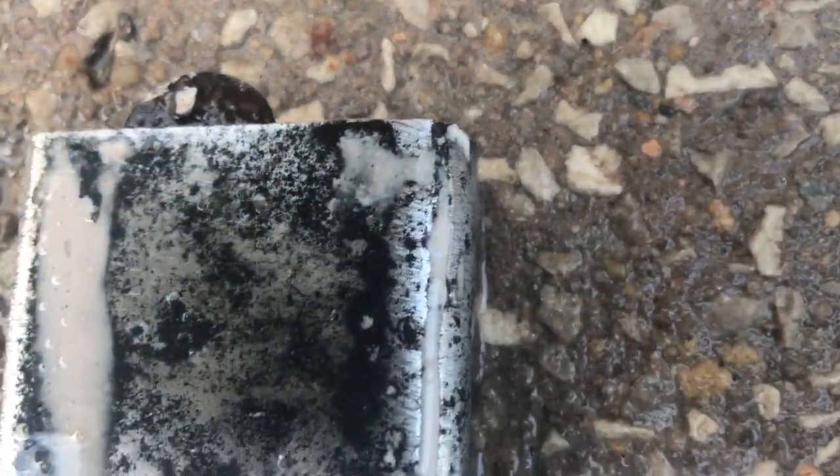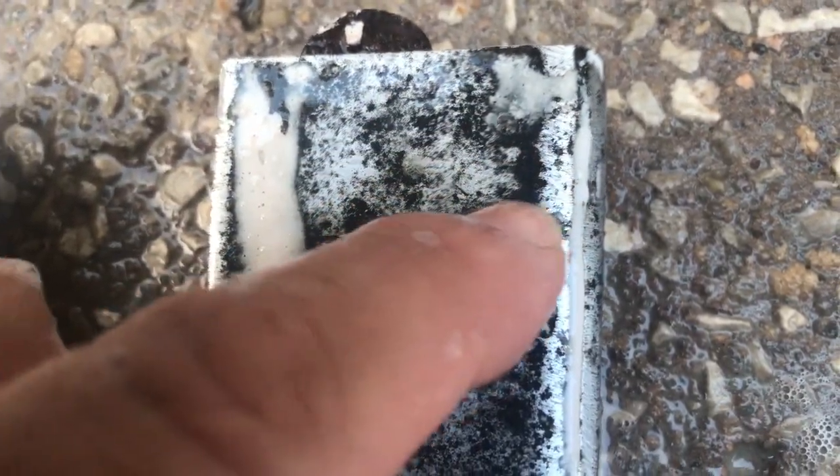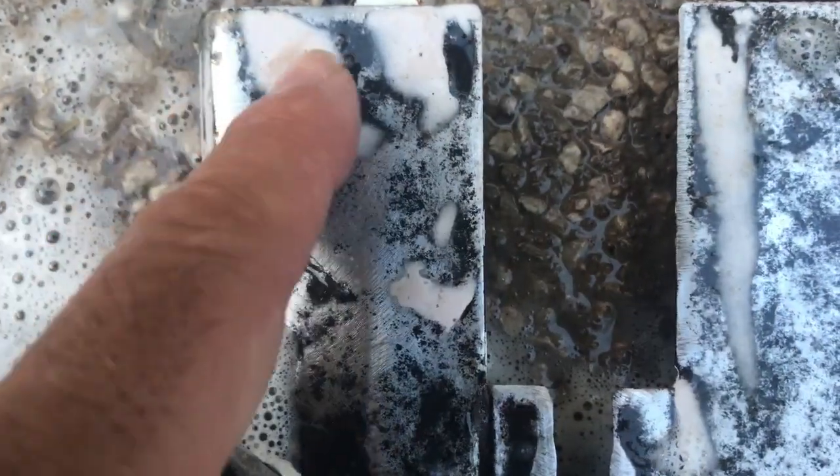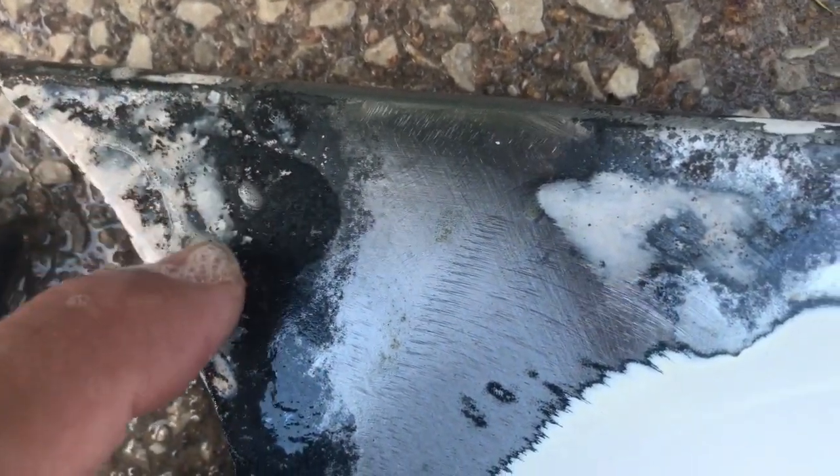Checking it with my finger all the time - you'll find that you end up with a hump in the middle. The edges will feel smooth but there'll still be a hump up in the middle, and the parts you haven't touched you'll feel a little ridge. We gradually get left with just the pits filled. You can see all these little white dots - these are all the rusty pits that are now filled. These bits I've already done and you can see that most of what I put on has been taken off again. The inside section - this is the section I filled the other night. Nearly all gone - just white dots where the pits were. I'm not quite happy with that edge, I might go over that edge again. This also needs some fine sanding on the edge of the paint where the flap wheel has left marks.